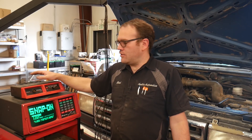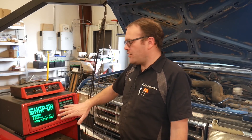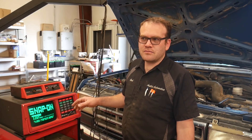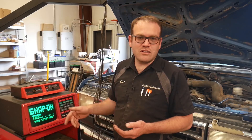What does PicoScope not have that I wish we had that this does have? Some of the waveform viewers are so much easier in this. When you boot this thing up, you pick how many cylinders you have, if it's a four-stroke or two-stroke, and then you punch in your firing order. There are buttons on the front — you select what cylinder you want to look at. Once you have a sync channel, you start your firing order at that sync channel, push the button for the cylinder you want, and it goes right to that cylinder and displays a nice clean signal on the screen.